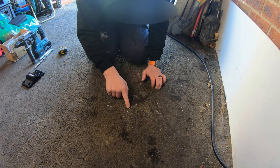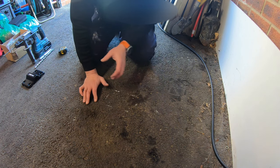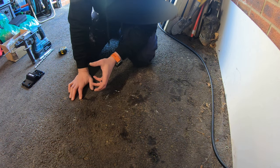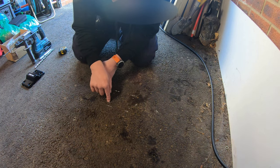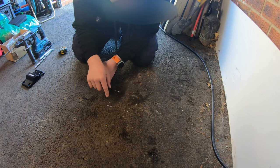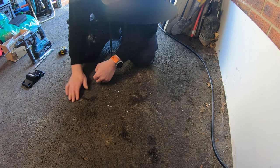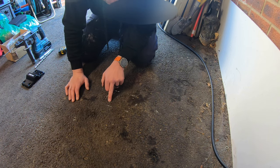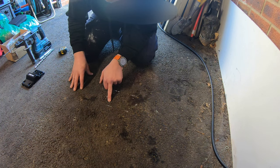There are your four little markings — you can just about see them on camera. The fixings I'm using look like big giant screws: they're 100mm long, the outer diameter is 12mm, and they have an internal thread of 10mm. They screw into the asphalt with chemical resin, and then you use their internal thread to bolt in the bolts that came with the ground anchor. We need to drill a 14mm diameter hole for them.